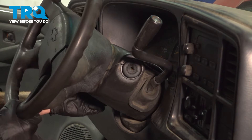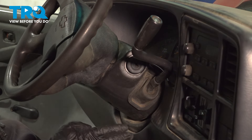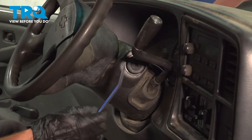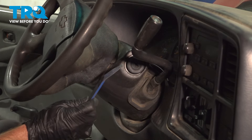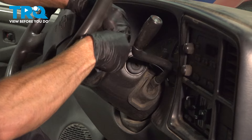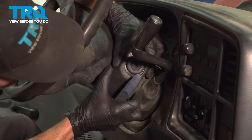If you were to tilt the steering column up, you're going to find that you have small ports along the bottom. Some vehicles will have mounting screws; others will not. You have to take a quick look and see if yours does — ours does not. I'll be separating the two pieces of trim panel with a small trim tool. Make your way in between the two panels and gently start twisting to separate them.